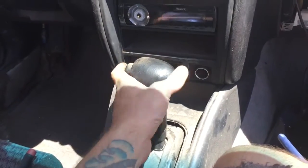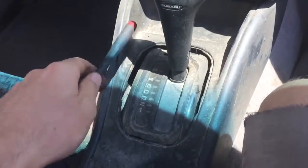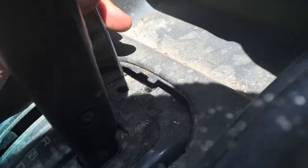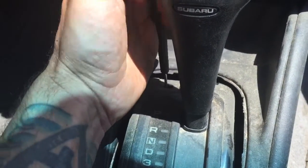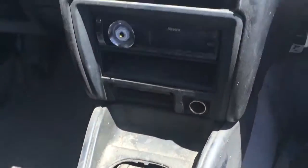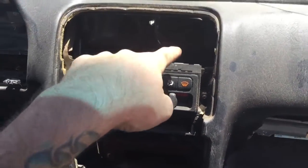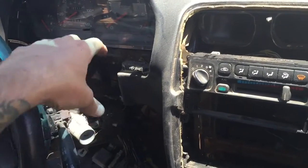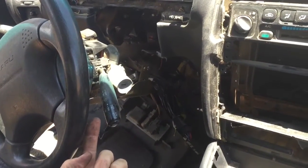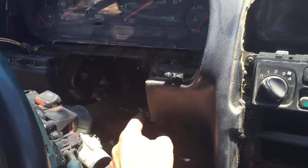Here's a cool little trick to get the main console out: on this automatic you have to pull this back, but since you don't have a key, generally you can't. So you pull the little bezel that goes around here and you'll see a hole right there - depress the pin in there and it'll come back. Now you have access to the console. Once you get these screws out in the console area, move over to the steering wheel, take the fascia off - two plates, upper and bottom - and underneath there are some Phillips head screws.